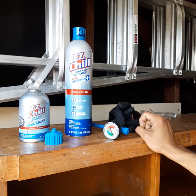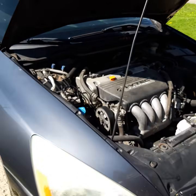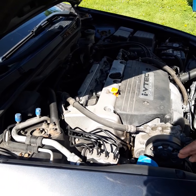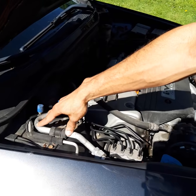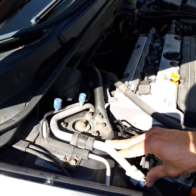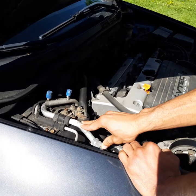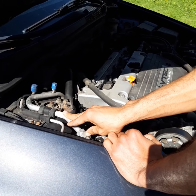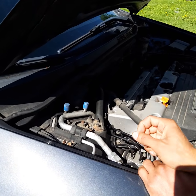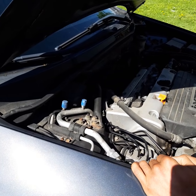We're also going to be using gloves and safety glasses. One of the things I emphasize is understanding why we're doing the job. If you want to do any job at home, you're doing it hopefully to save time and money, but it's good to understand what you're trying to fix. The AC system is normally a sealed system, so there should be no need to recharge it — if you are recharging it, it's because you have a leak. You could take this to a mechanic to have it inspected and fixed, or you can add refrigerant like I'm doing, but that only helps if the leak is small enough to hold a charge and last the whole summer. If you're having to recharge constantly, you might be better off taking it to a mechanic.